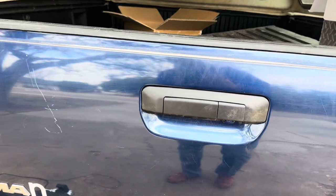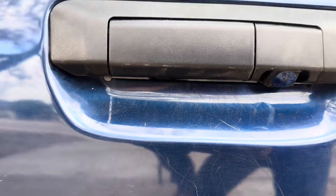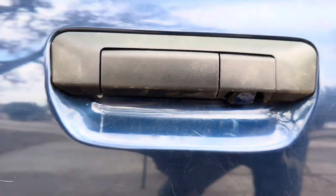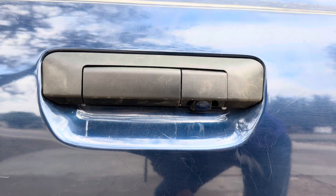There's one thing on this reverse camera that I'm not too crazy about - see that gap under there? There's a gap right across the bottom that doesn't fill in. I guess what I'll do is run a little bead of silicone across there to keep water and dirt from getting in there.